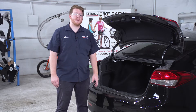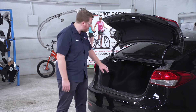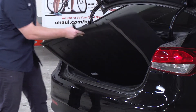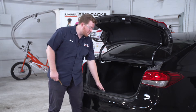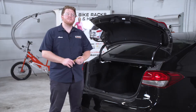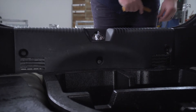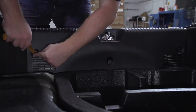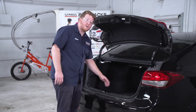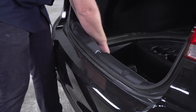Our trailer wiring is going to plug into our vehicle's tail lights, so we need to gain access to the tail light harness behind the paneling. We're going to start by removing the flooring. Next, we'll remove the rear threshold panel — it's held in by three push pins, which we'll remove using a trim panel removal tool. Once those push pins are removed, we pull up on the rear threshold panel and set it aside.